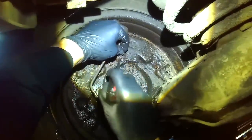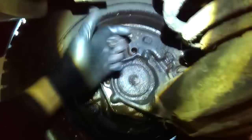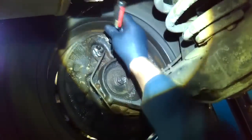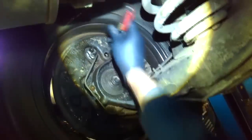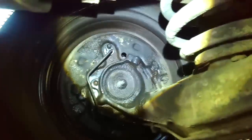After bleeding, take this — it's just water — and wash off any brake fluid with water. Take out this plug and feel for the self-adjuster. Ratchet it until the wheel starts to drag a bit — it's dragging a little right now. Then pump the brakes, which re-centers the shoes. Do it a bit more, and that gives you a nice firm pedal and a good handbrake.